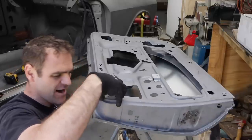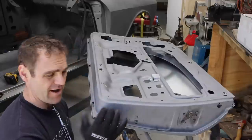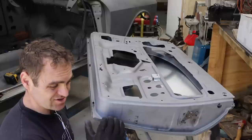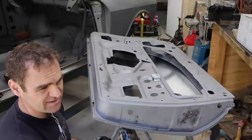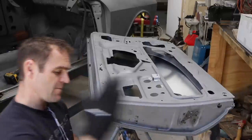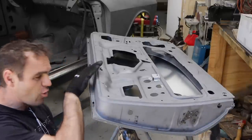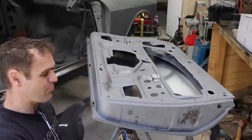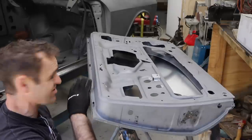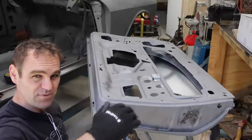I've laid my skin down with the door frame inside the skin — you can see it's just got a bit of an overlap all the way around. It's pretty simple to fit these door skins: you just tap them over. You can't try to do it all at once — you need to very gently work your way all the way along each edge, backwards and forwards, and just gradually creep the whole thing over all the way around.